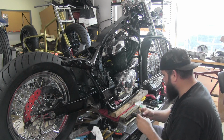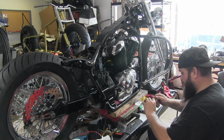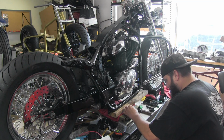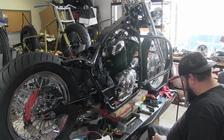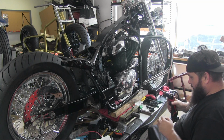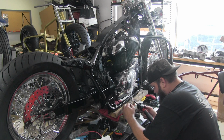So, go ahead and get all these wires tinned. That's something I think I haven't discussed actually. I don't know how many people know this or don't know it, but whenever you're soldering, I find it easiest to pre-tin all the wires. So you basically flow some solder into each wire.